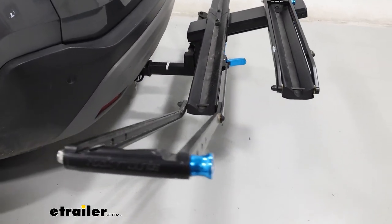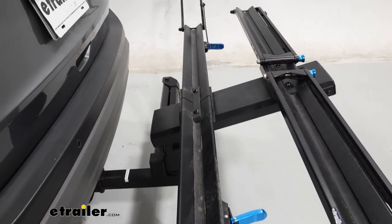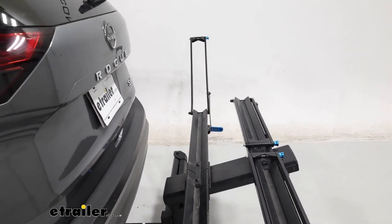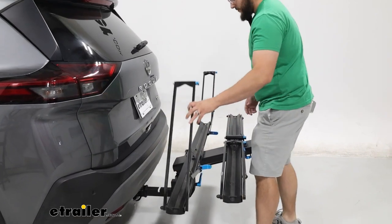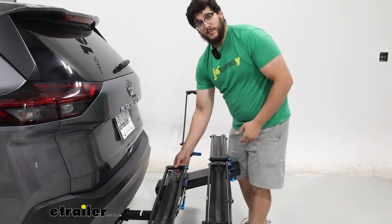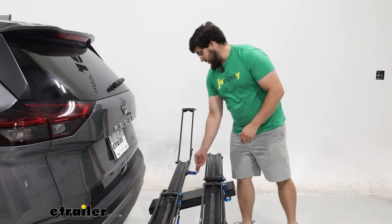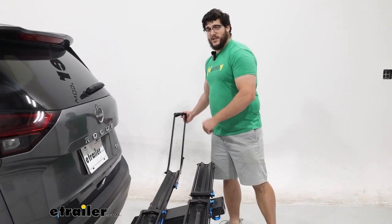With the bike off, I can take it out for a ride. When you're driving with it, you want to make sure you put everything back up too. That's really easy to do with this rack — you have two options. You can just leave that button up and push it back down. The important thing is when you push it back down, push that lever down so it locks into place. On the other side, you can actually just start by pressing that button down, and instead it's going to ratchet into place.